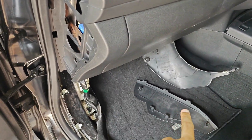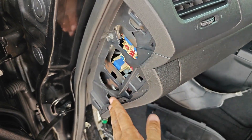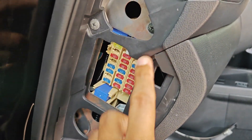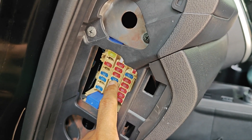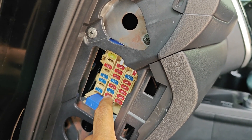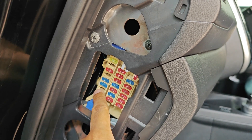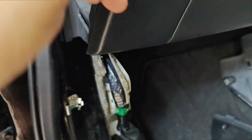I've removed two panels from the car. The first one is the outer cover of the fuse box right here, and we'll be tapping into one of these lines for the 12-volt constant power. I've already checked — all of these here in the center column have 12 volts all the time, so you should not be using any of the ones on the side.